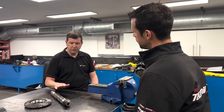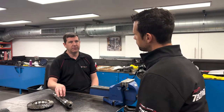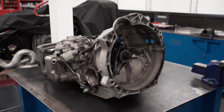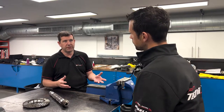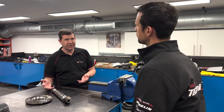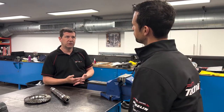So as a way to lower the gearing in the GT4s and Spider transmissions, why was this our chosen solution? There are obviously other ways — you can change the individual gears on the shafts — but on these gearboxes, a couple of the gears are actually part of the input shaft, so they can't be independently changed, meaning you'd have to change the input shaft and gear sets as well. This was a simpler way to achieve largely the same thing. It also gives the option of altering sixth gear to essentially give an overdrive, and some people prefer a low ratio throughout while others prefer a higher sixth gear alone, for example if they're spending a lot of time on the autobahn. So it really means we can tailor it better to what an individual wants to do with their car.